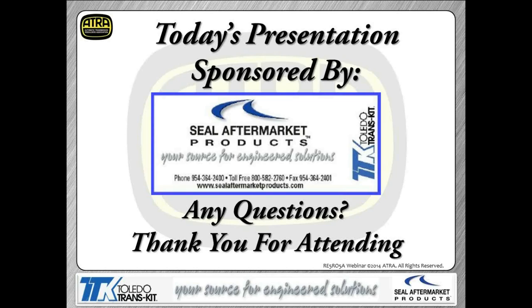Now, these ratios can actually be found on Mitchell's or ALLDATA. I spent a long time going through all of the information I could find to update this chart to the latest model years. Now, in this chart, what you're going to notice is I have an asterisk here, the 2009 Pathfinder, the 4x4 ID tag. There are 2 different numbers that fit the VQ40DE engine that take the A ratio. So what you're looking at here is you'll see 3 numbers listed. These 2 actually go to this engine, and that would be an A ratio. Now this last number on the right, that's this one here, it goes behind the VK56DE engine, and that would take the actual B ratio.